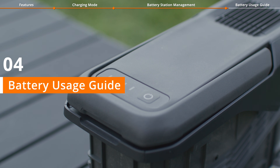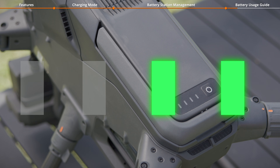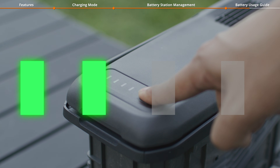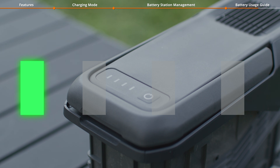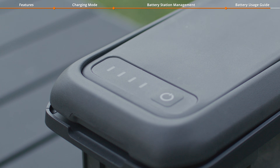When the battery temperature is below 20 degrees Celsius and the battery is installed on the aircraft, it will automatically start heating until it reaches 20 degrees Celsius. The battery will then enter Insulation Mode, which lasts for 30 minutes. When the battery is not installed on the aircraft, press and hold the battery button for 5 seconds to activate heating, and again to exit. In low temperatures, wait for the battery to complete self-heating before use.